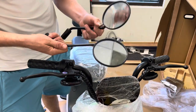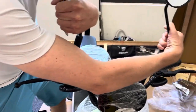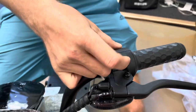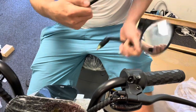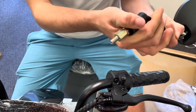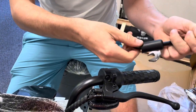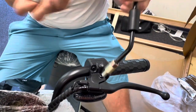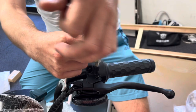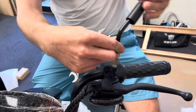Next, find your mirrors and make sure each is on the correct side — you want it like this, not like that. There are small points with a plastic fitting you can pop off with your nail. Lift this plastic up and you'll see two bolts. Push it up far enough — it takes a little force — then get your hand in, line it up, and spin it in. Sometimes you have to wiggle it around to get it in good.